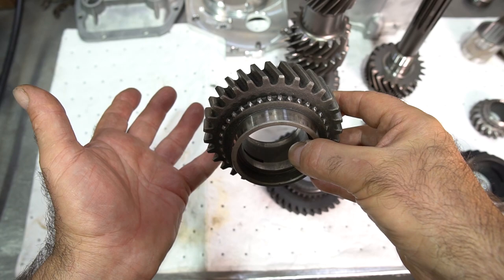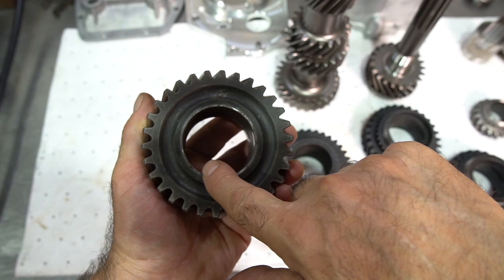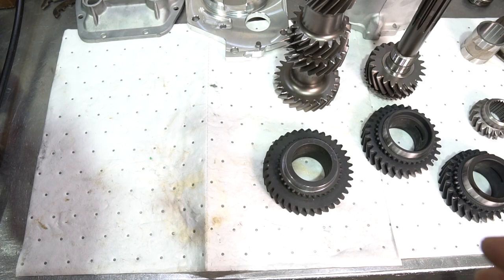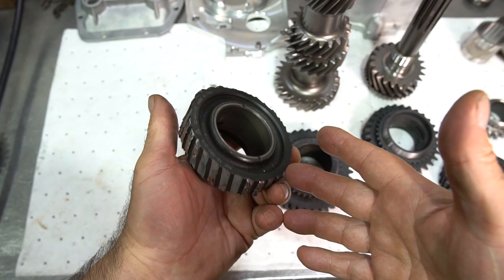You want to check for any type of galling on the surfaces where the gear might have been running hot. Sometimes you'll see that the metal has been displaced from the flanges. Make sure everything looks nice and smooth. Obviously this gear has been broken — a nice hard one-two shift at the drag strip peeled the teeth right off. That's very obvious, and you're going to have to change that and the matching gear.